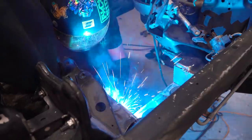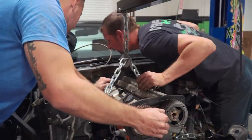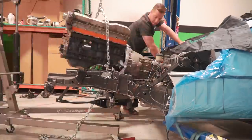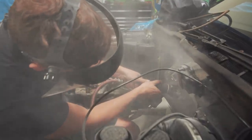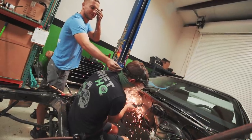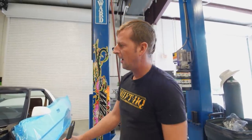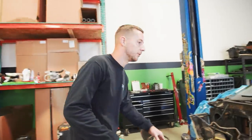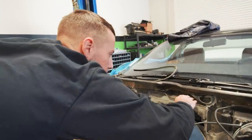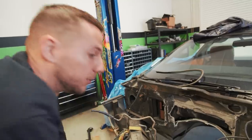Fire safety crew. Here is the remnants of said firewall. We're going to make a new aluminum plate for it — block it off — but we're going to test fit first to see if we need any more clearancing to make the valve covers fit. Made a lot of room. My main interference point was a big notch out right here, but the motor sits down to about there. So with that amount of clearance, I think we'll be all right. We'll give it one good test fit before he starts flat sheeting everything just to make sure we don't have to go further.